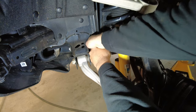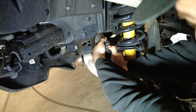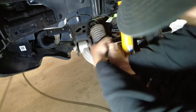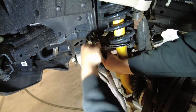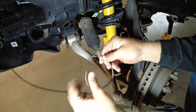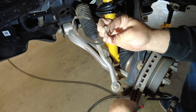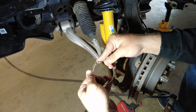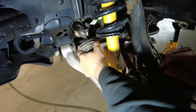Now you should be able to pull your boot all the way out just like so. We just put our flathead right there and it pops that off. We're gonna replace that with a hose clamp - don't worry, it's gonna be better. Now we just simply remove our tie rod.